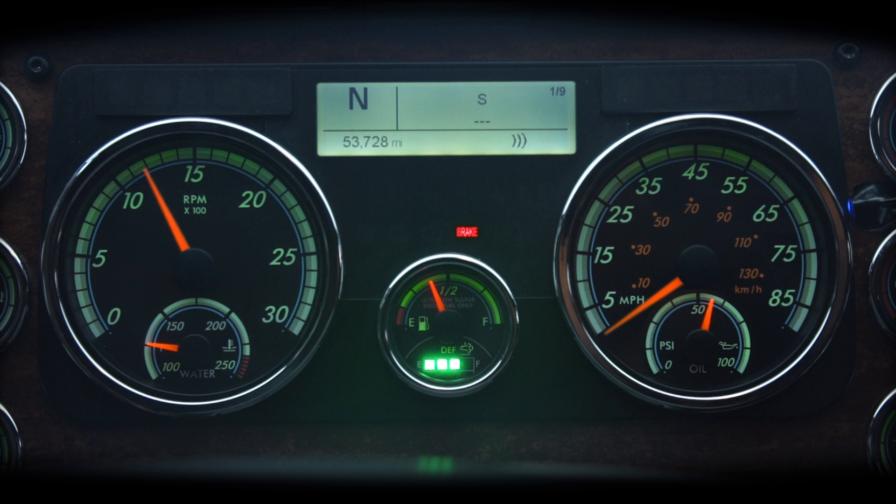Step 6: Engine speed will increase and the Diesel Particulate Filter lamp will go out if regen is successful. The High Exhaust System Temperature Lamp, or HEST, when solid, indicates the exhaust is at high temperature and the vehicle is at low speed or parked. When flashing, a parked regeneration is in process and the system is not up to temperature. A parked regeneration may take 40 to 45 minutes.